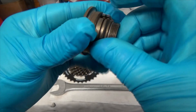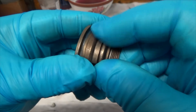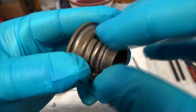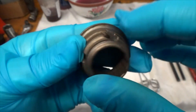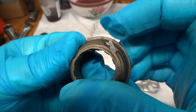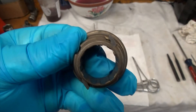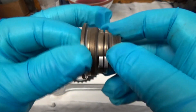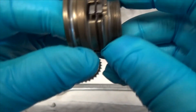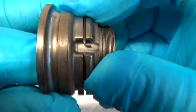If you want to put a drop of oil or a little bit of grease on there — a lot of bike mechanics will tell you don't put grease in here because it'll want to keep the pawl depressed and make it stick down. But if you want to put a drop of oil in there, that's fine too. Let me show you — see it? That's how it's working.